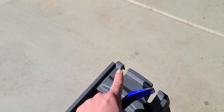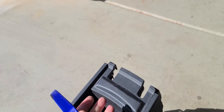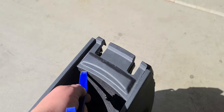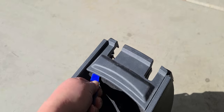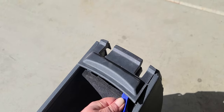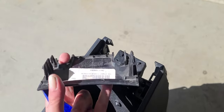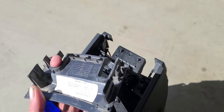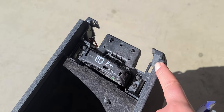To begin, I removed the armrest — you do not need to remove this armrest, I did just so I have a clearer shot with the camera. So let's get this cover off. You'll notice there are four total clips: one on that side and one in the back, one on the other side and one in the back.